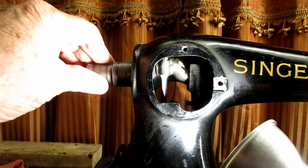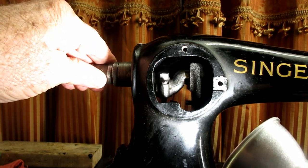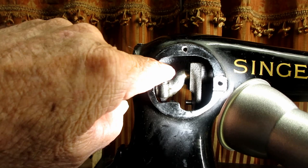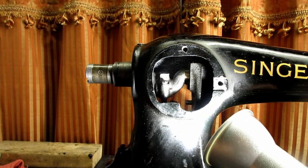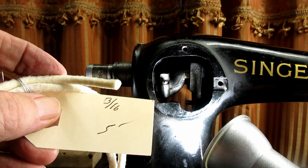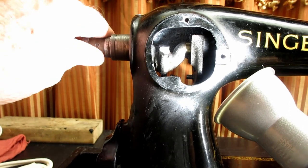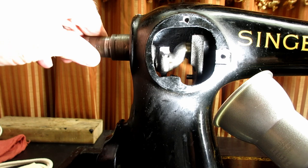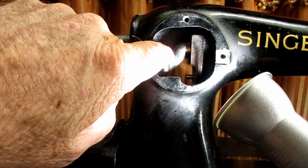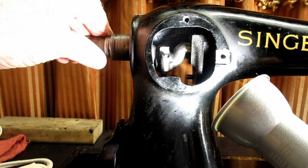Okay. Yeah, I'll probably put one or two more drops of oil in there just because that felt was brand new and dry. And it's swollen up a little, I can tell a tiny bit, but it's still way well below the top of the oil port. So I'll put in the description below the video a link to the firm felt cord page of McMaster-Carr if you want to go take a look at it. Maybe if you're in a sewing group or something, you guys want to split the cost on it or something like that. But that's the crank connecting rod cap oil pad felt, is how it's described.